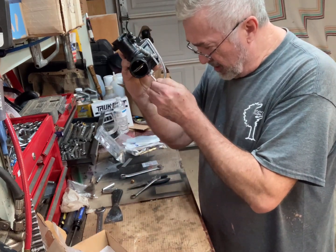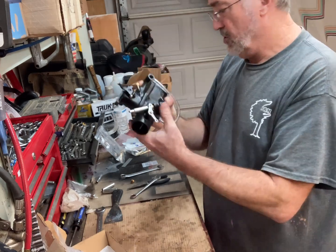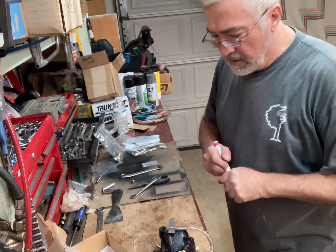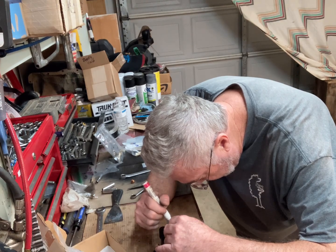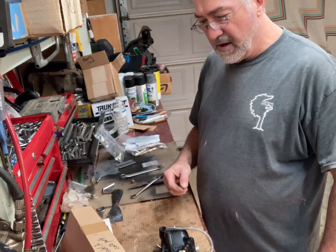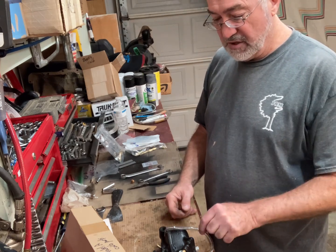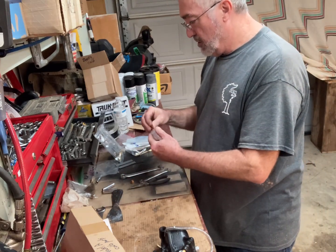You need to not crimp it down here so it blocks the fuel flow, but still have it where it'll flow. What you're looking for is the fuel level at the mating surface right there. I'm going to put a little mark on the tube just to make it easier to see. We should be good to hook it back up and run some fuel in it. Remember, once you do that you'll need a catch basin to catch the fuel when you take this back off — you don't leave this on. Then put your plug back in. Let's mount it back up on the car.